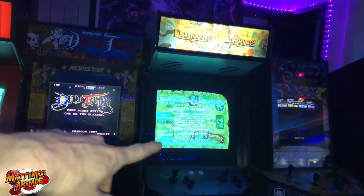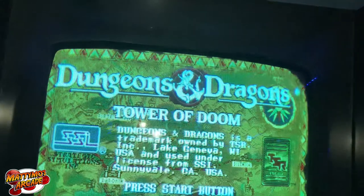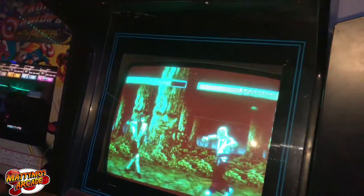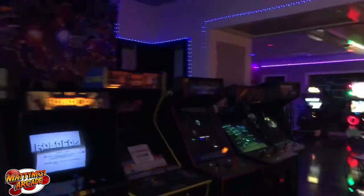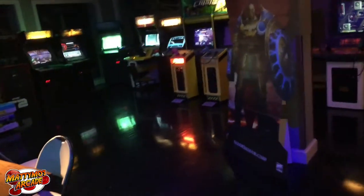This one here I want to mess with the purity rings on — the colors just don't pop right and the color palette is a little weird. I'm talking about this Dungeons and Dragons cabinet, just not good enough. There's a couple over here that drive me crazy — see, there's like no red, but you can see red in the background. There's a fix for that too, that'll be another video. This cabinet is having problems: first the TV wouldn't come on, now it boots and reboots repeatedly, so I think it might be a power supply issue.